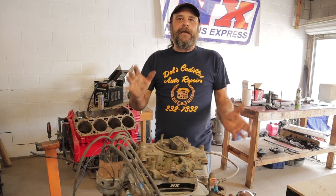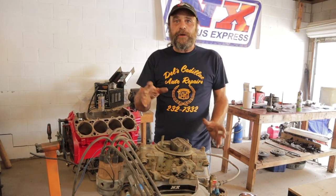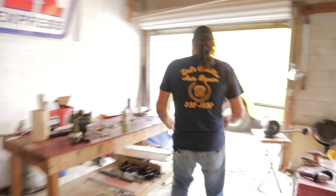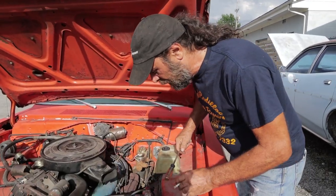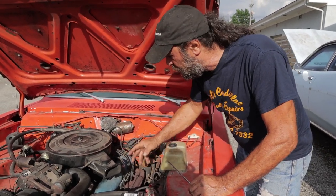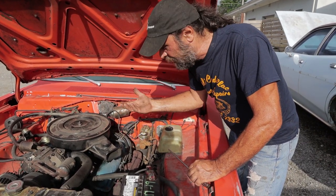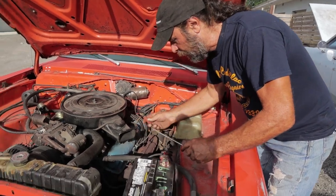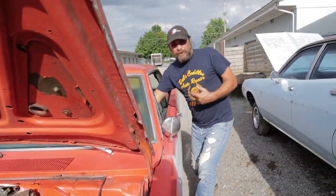At the risk of being overly simple — and you diesel guys can go on to a different video at this point — I'm going to show you the basics, how to do this. You can pause the video and go out to your car right now, pop the hood. The ignition system on this car is just a regular stock single-point Chrysler ignition with a stock coil and carbon wires. This is the absolute minimal system you're ever going to encounter on a high performance car. Pull a plug wire off any plug, insert a screwdriver into the plug wire like so.